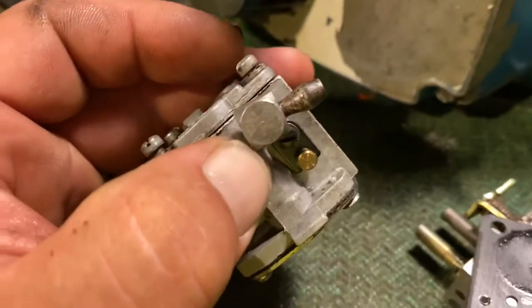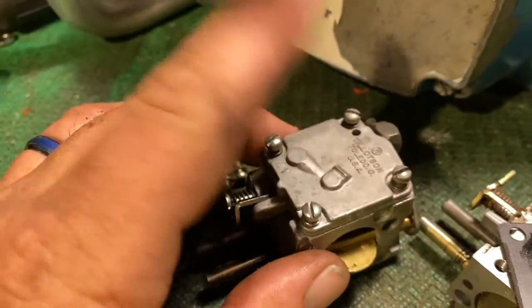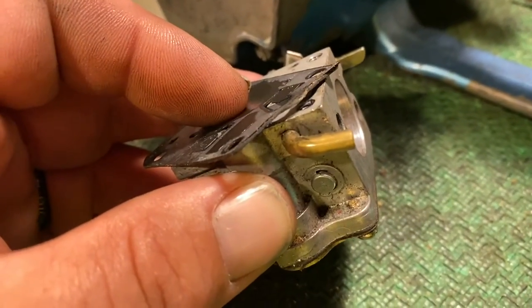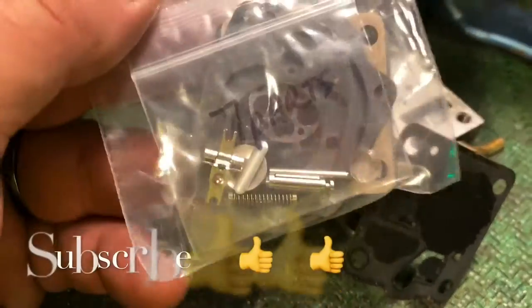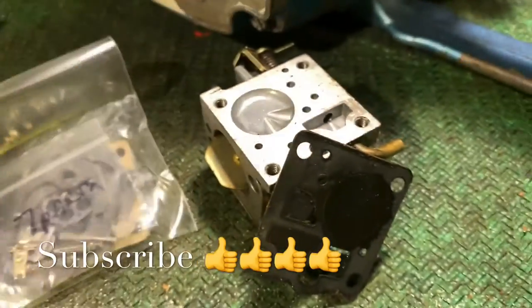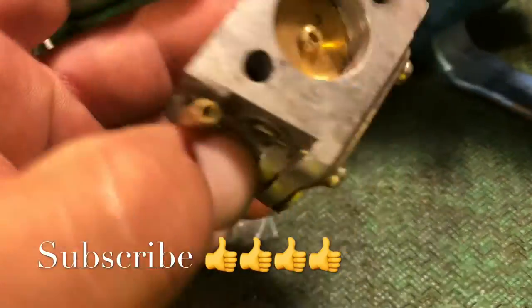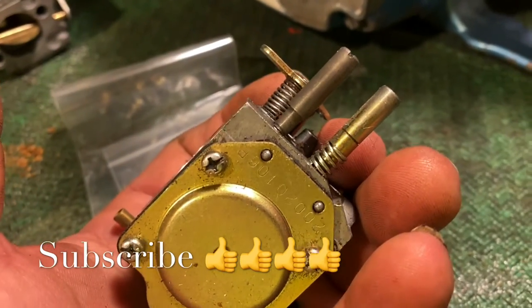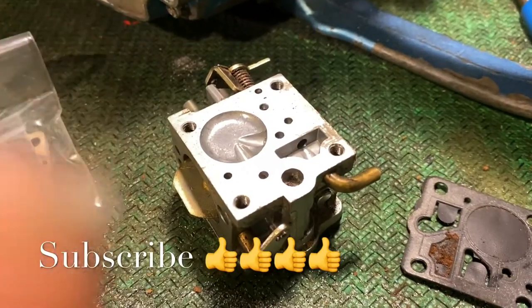I don't have any way of replacing the inlet port to get a better fit, and I don't have any replacement gaskets on hand at the moment. But here's what I do have — I have this Zama. It has the correct size inlet port, and I have a kit for it, so that's the route I'm going to go, just because that's what I have on hand. A lot of people don't like these carbs, but I think they work just fine when they're running. It's whenever you have issues that they can get a little finicky. I have no problem using this carb. It's missing a spring here — I had stolen it for another one. I'll just steal it back from another carburetor and get it working again. So we're just going to put this kit in this carburetor, install it, and see how she goes.